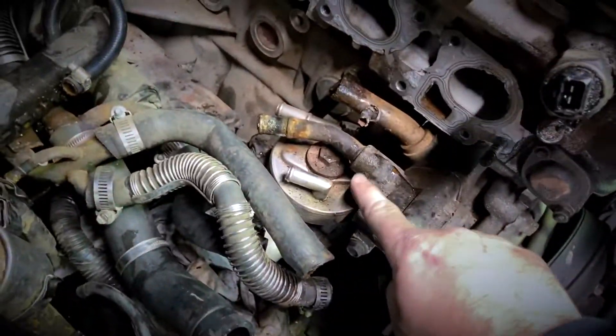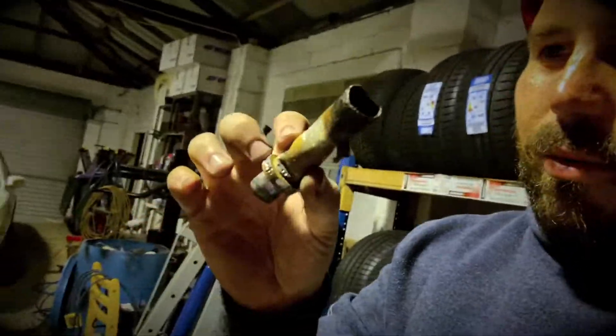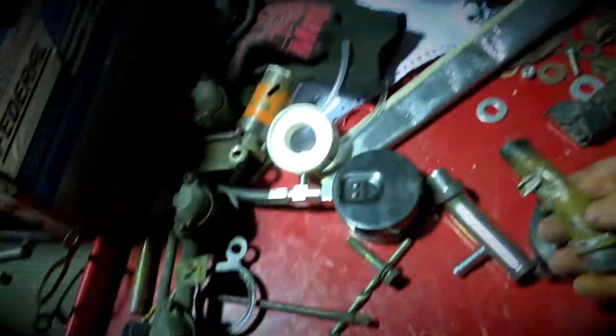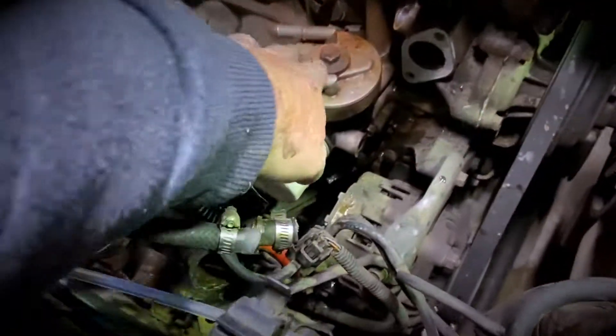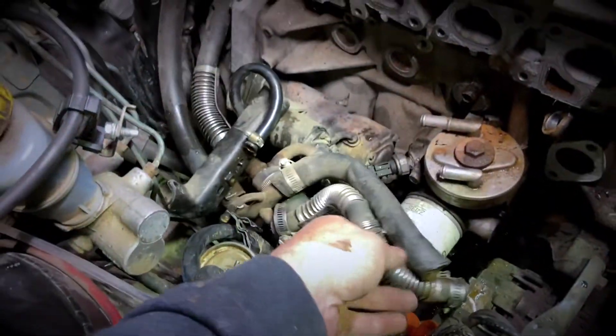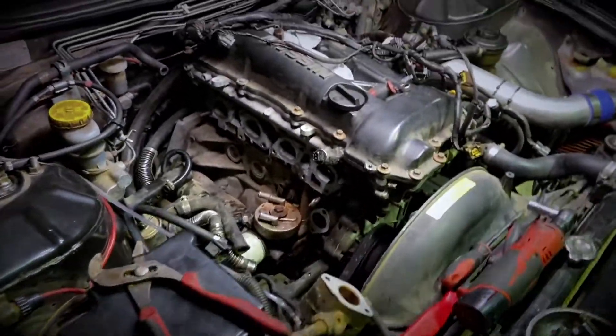So this is what I think was the problem. Most of the water was coming out of here, here, and here - and not actually a head gasket, which would be absolutely amazing if we didn't have to replace that. The culprit is pretty haggard as you can see. I think if I replace that with this one, that is the water leak problem sorted. The oil cooler relocation kit also gets rid of some of this existing plumbing.